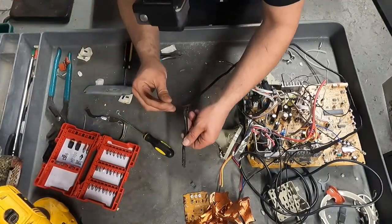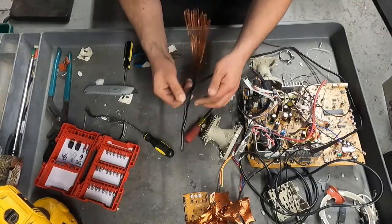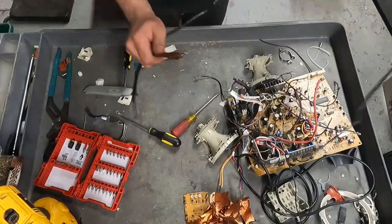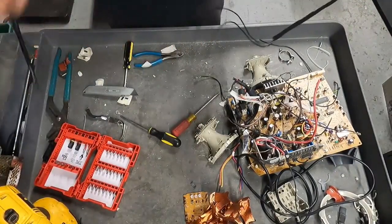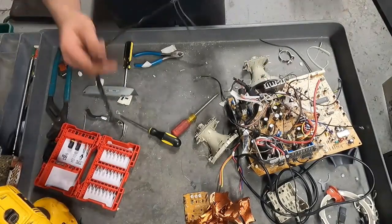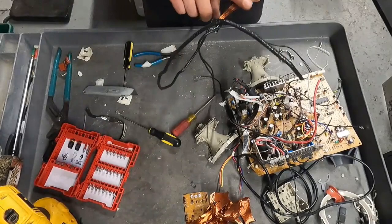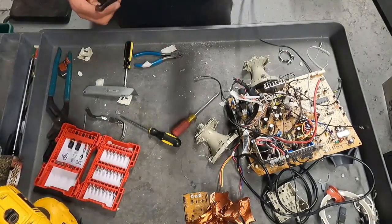So there's usually a small thin layer, which I can't find it, but just take my word for it. But this is pretty much the easiest way that I've found to strip these. It might take you about 2 minutes to do it, but it's definitely worth it because most of the weight from the monitor for copper is inside this degaussing cable. And the bigger the monitor you have and the thicker the degaussing cable, the more copper you're gonna get.